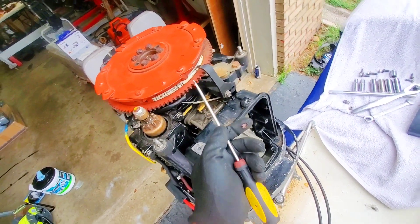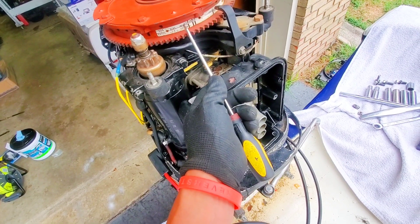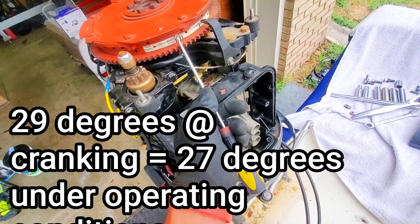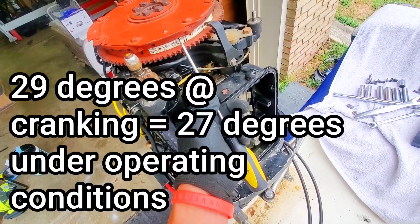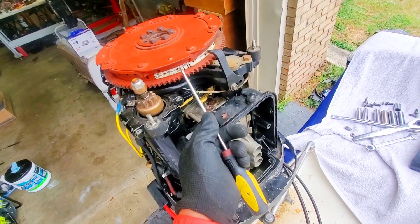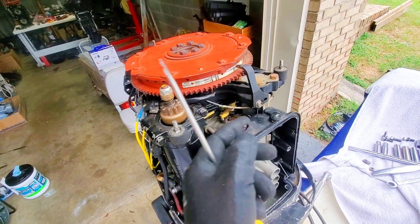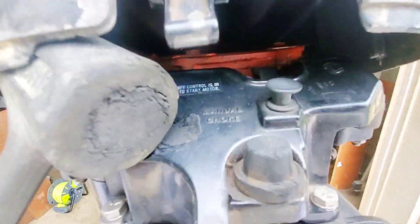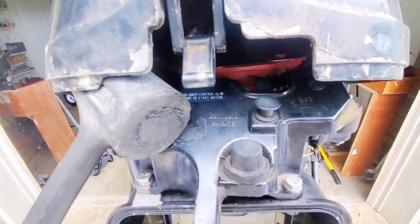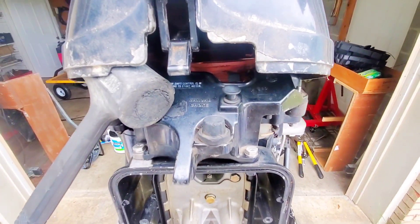We're going to start timing this thing. The idle needs to be set anywhere from zero to three degrees per spec. Then we set the timing — the spec calls for 27, but given the ADI ignition system we set it to 29, which equals 27. So we're actually going to set it to 28, that way the max spark hits 26 — because you want to trim down the max spark just a little bit since today's fuel is lower quality. I've got the timing light hooked up, shroud over it, need to read the markings.